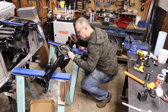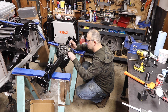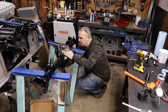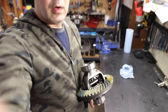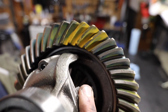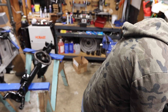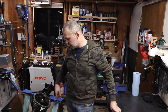You really do need to buy a clamshell puller, because my janky bearing puller could easily damage the bearings. The pattern is nice and round in the middle — really not mad at it. Coast side: nice and centered. Drive side: it's a little faint but it's centered. I've got a good pattern, ladies and gents. I'm calling success. I still haven't set my pinion preload, but if I screw that up again — I kind of get it now.